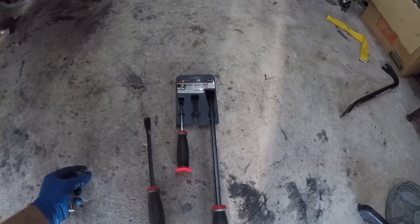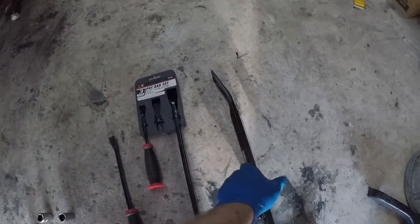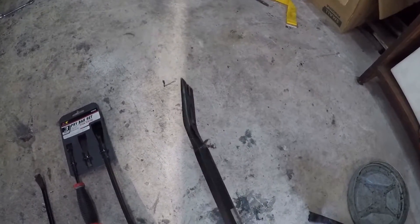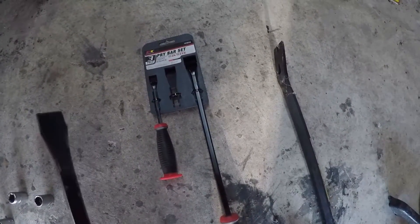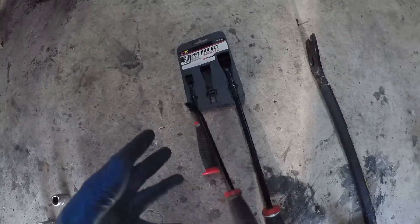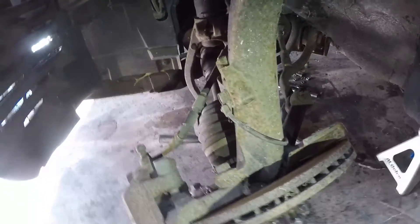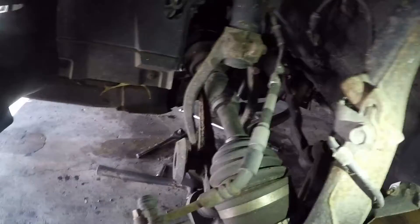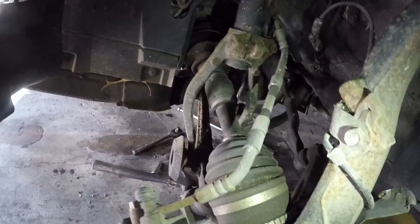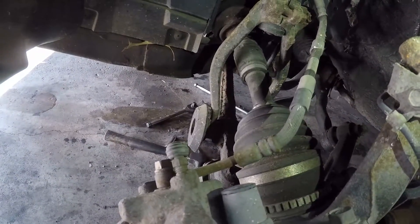I was struggling to get the driver's side axle out for probably an hour. I finally decided that my pry bar was too big — the end is just too big to fit in the little space between the trans and the axle. So I went and picked up this tool from Advance Auto, it was like $12, and I got it out in literally five seconds. To get the axle out of the driver's side I took the upper ball joint loose and then just leaned the whole knuckle over. It slipped out just enough from the transmission that I can leave it like this and it'll be fine. The only thing I'm worried about is this brake line has tension on it — it's not a lot of weight but this thing is kind of old. Worse comes to worse if it breaks I'll just buy stainless steel.